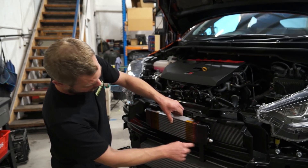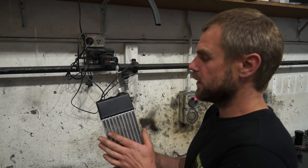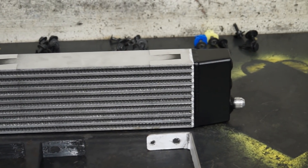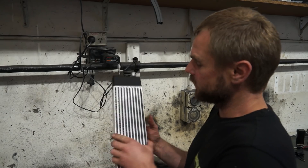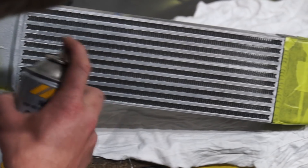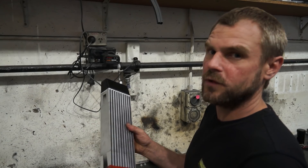We're going to have a 180-degree bend that comes around the front and runs along the bottom — no holes to drill, it'll be perfect. I want them to look like factory parts, so we use a texture black finish to represent plastic. I personally don't like powder coating the cores, because putting a coating over something that transfers heat acts as an insulator. So what I do instead is paint the cores with zinc gal, which stops the core from oxidizing and keeps it looking clean for years.